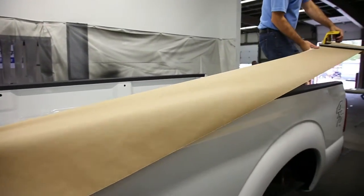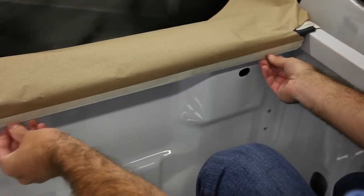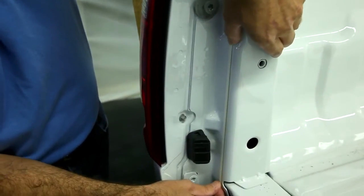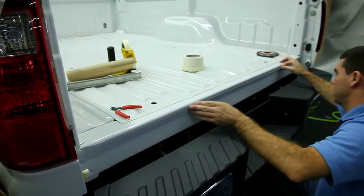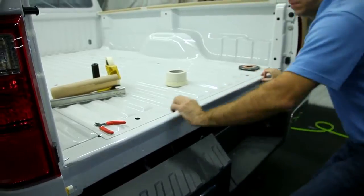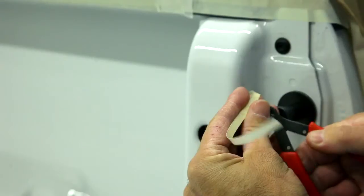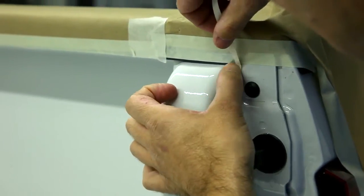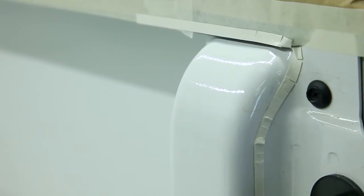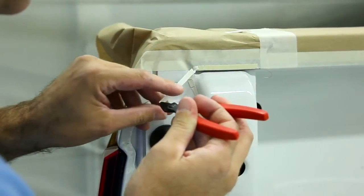Again, depending on the truck manufacturer, masking of existing rail caps may be necessary prior to applying wiretape. Then use wiretape to create a straight line around the truck bed perimeter that has just been cleaned. This will create the edge where the Rhino Linings bed liner and the factory paint meet. The snipping tool is extremely important here to create smooth and uniform curves and corners. The tailgate opening is very intricate, so watch closely how the technician follows the contours of the truck bed with the wiretape. Continue snipping the wiretape around the corners until the entire truck bed is complete. Remember to leave a 6-inch tail of wiretape, then peel the backing off.